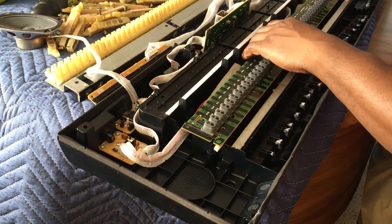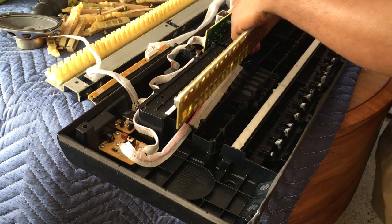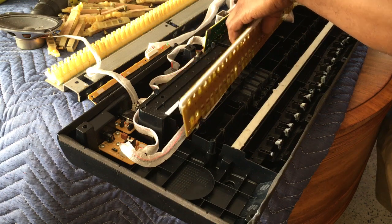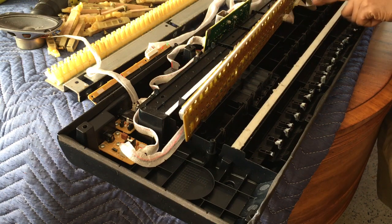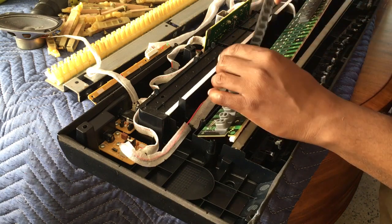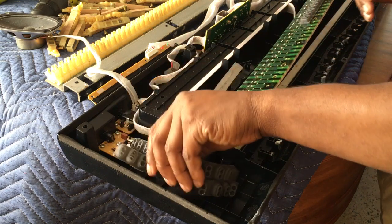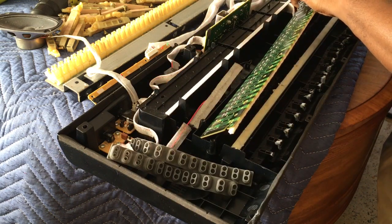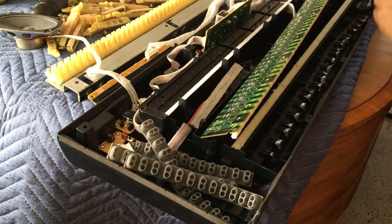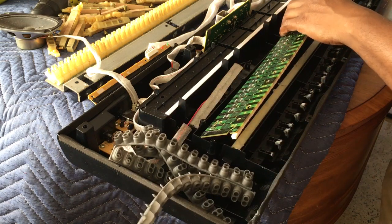And underneath here, this key contact over here comes in two pieces, which is really neat. So what I suggest you do if you want to still keep the chassis, and these contacts will always come out, that's no problem because they're all the same size. I take the contacts out anyway because I have to clean the board, and basically any little dust particles that are in there, I have to clean all that up.